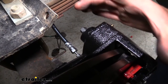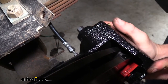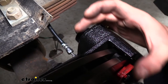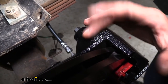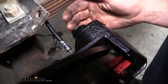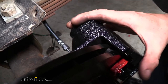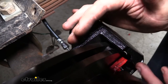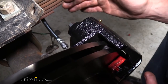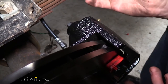The stainless steel hardware is really nice because our caliper needs to slide on these pins here — these bolts don't just hold it solid. The caliper needs to slide on these pins back and forth, and that's how it clamps and then loosens to keep our brake pads from dragging on either side of the rotor. If you have a bolt made of other materials that can corrode, it can inhibit the sliding motion and potentially cause your caliper to bind on one side, wearing down that pad and decreasing the life. With stainless steel, it's going to have nice, smooth operation for a long time.